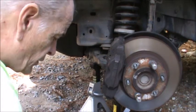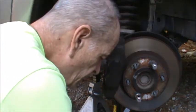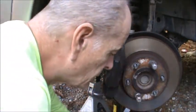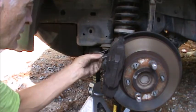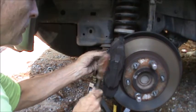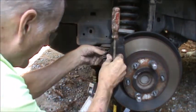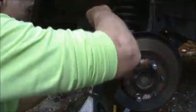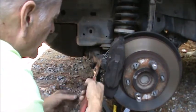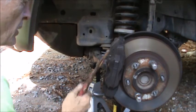Like I said, these things get changed every 20–25,000 miles. This time I actually found new hardware in the toolbox for the springs. So you slip the spring on, push it through some more, drive it through if you need to. Don't miss your other hole. There you go — and once it's through, you're jamming.